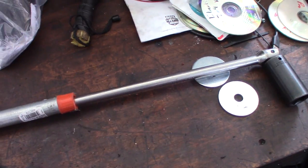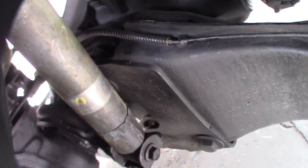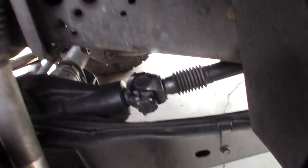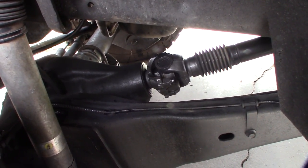My air impact wrench can't do that either. Let me show you where the bolts are. These bolts right here - not the track bar, this is actually the control arm. This is the one that was loose. It wasn't even loose, it just wasn't tight enough. I had checked those before to see if they were loose. There are some other bolts back there too, but for me, the front ones were loose, so I torqued them down and no more clunking or popping.